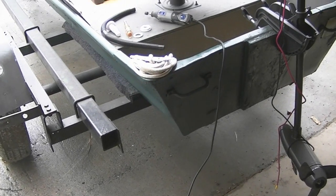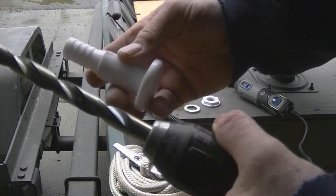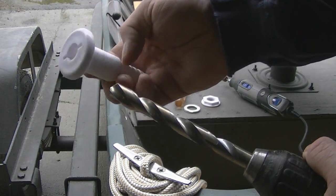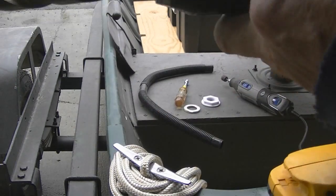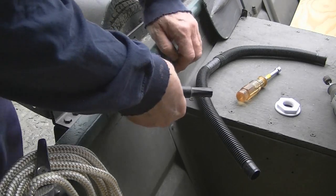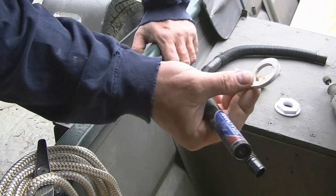What we're going to do is drill a hole in the side of the boat and put in this bilge pump. We're going to take a drill bit that's basically the size of the nipple portion on this through-hull fitting, and then do the rest of it with a Dremel. We took a marker, put the gasket here, and traced the inside diameter of the gasket.